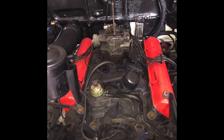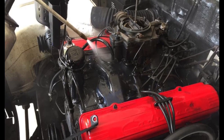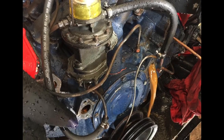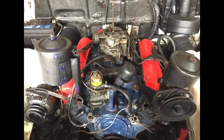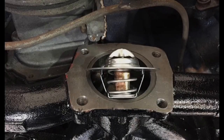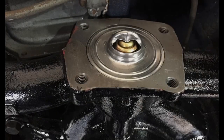The engine was very dirty and didn't look nice at all, so we started cleaning it — taking all the grime and dirt off with high pressure water. The radiator had just water, not coolant, so we flushed the engine out under pressure and you can see a lot of rusty water coming out of the block. It wasn't looking too good. I painted the water pump black for now, as I knew I was going to paint it the correct color later, and I used a new thermostat.